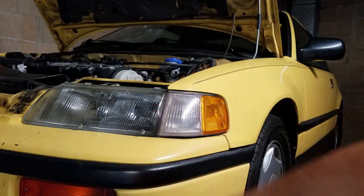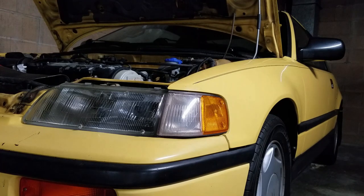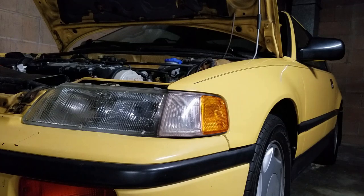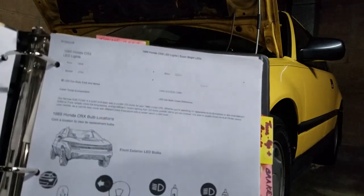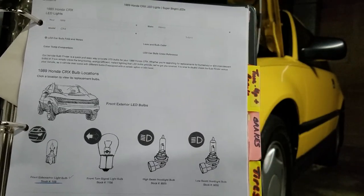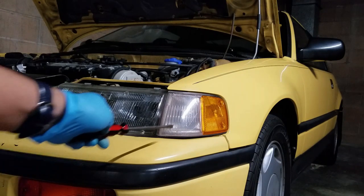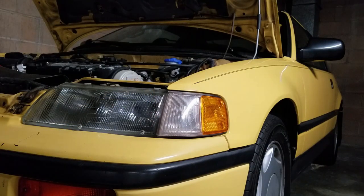I have to pull this thing out, but I want to show you how to do that. The other thing I want to do is show you this website which has been really helpful for me - superbrightleds.com. What it has helped me do is find the actual stock number for the bulbs that I need, so that way I can get the LED version. In previous videos I mentioned the side marker bulb, which is stock number 168. The turn signal bulb is a different stock number, and the front turn signal light bulb is number 1156.